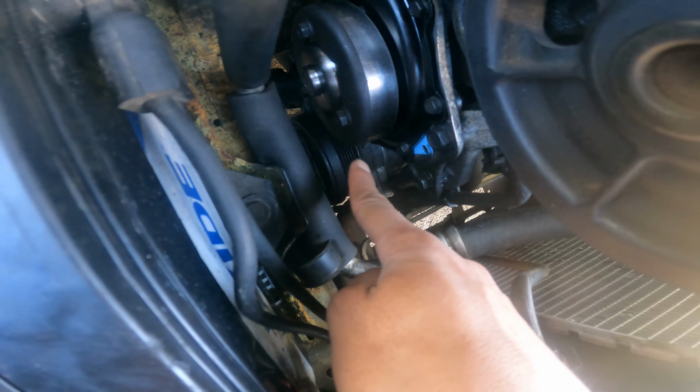Now I'm about to attack the AC compressor. In order to get to it, the easiest way is to take the tire off, take the wheel off, and go through the wheel well. There are a few bolts that you have to get off. You got to pop that pop tab out. That'll come down, and then you got to take this tin right here out. And that'll give you access to the AC compressor where it sits. I think it's maybe three bolts holding it in.